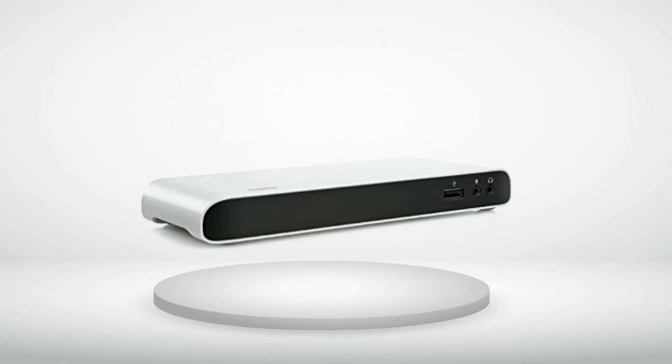As another reviewer said, you can only connect 2 monitors to the dock if one of them is an Apple Thunderbolt monitor, and the other is HDMI. But what it did not make clear is that, if you are using one of the Mac's built-in Thunderbolt with a DisplayPort monitor, then you can't plug an HDMI monitor in through the dock. If you are using DisplayPort in any way, shape or form, you can't run a second monitor through this dock.